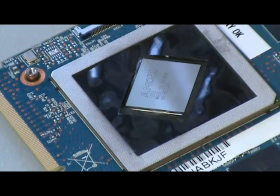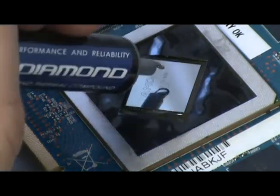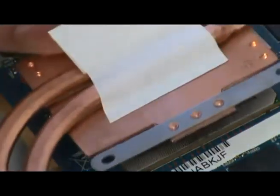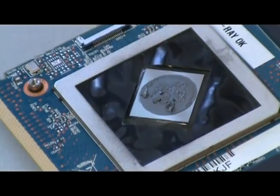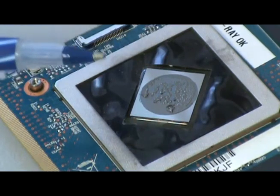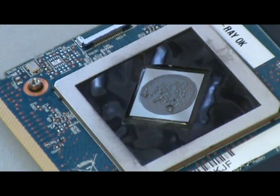One more time, here we are again with our AMD HD 7970. I'm going to show you what too little thermal paste application looks like and why it's insufficient for cooling your video card. So we'll just apply just a little bit there — it's not very much at all. When the heat sink is compressed on it, you can see that while it did spread out evenly in a circular pattern, it's not covering the entire die, which means you're only getting thermal exchange over part of the GPU die. Ideally you want full coverage, about that thick, just covering the whole die to get optimal thermal transmission.